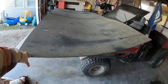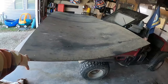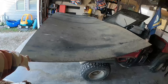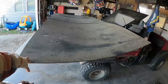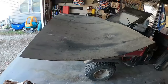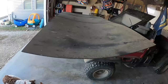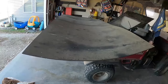This stuff is a pretty hard rigid plastic and it works pretty good for this. Cutting it isn't too bad - I've used a Dremel for close tight cuts, an angle grinder works pretty good, and a sawzall will work pretty good too. Make sure you've got gloves on and a shirt you don't mind getting nasty because this stuff leaves a lot of black powdery residue while you're cutting it. We're going to get it mounted up on the Mule now and start marking some areas and cutting.